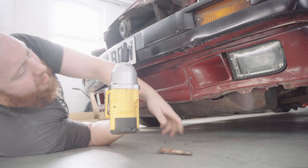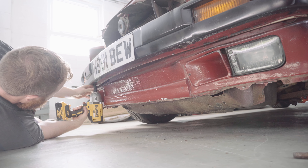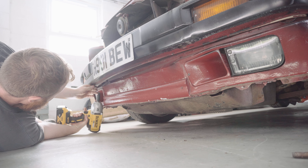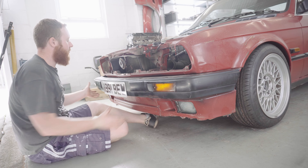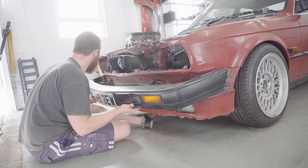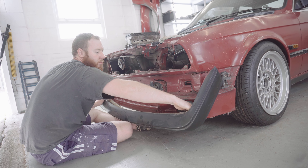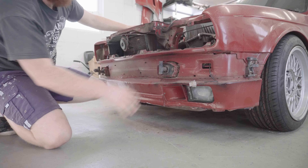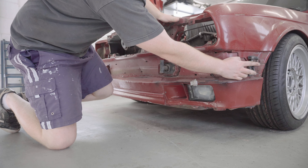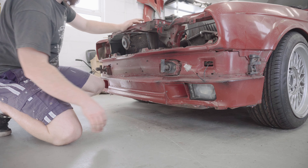Well that wasn't in tight - it was barely in at all. So that's the front bumper off and that was easy enough. It's just the same as the rear really - the Torx bolts and then it slides off these rails and comes away. Be careful not to pull on the indicator wires because that would be a pain if you snap those.